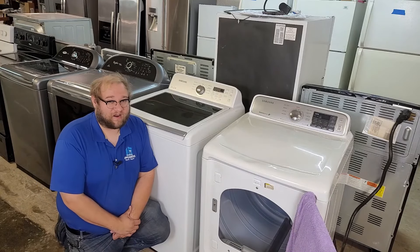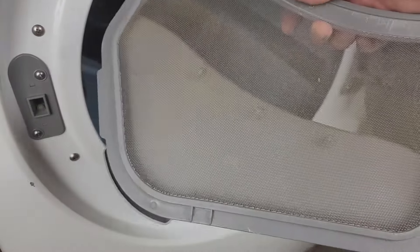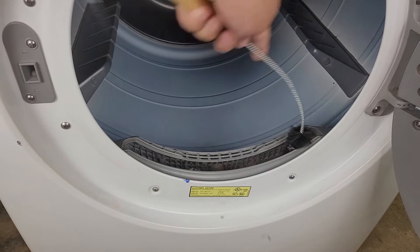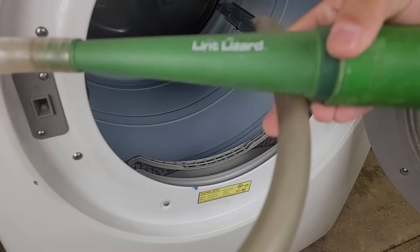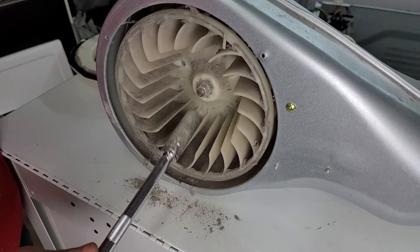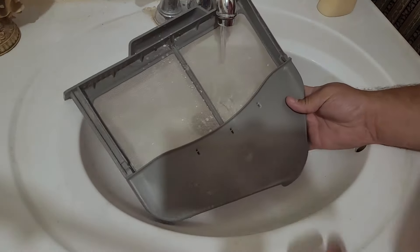One of the first and most important areas to deal with on a dryer is the lint filter. Most people know you're supposed to clean the lint filter after every load, but you can't really stop there — you want to clean the inside compartment every month or two. One way is to use a condenser brush to break up any caked-on lint. An even better way is to use a lint attachment on a vacuum cleaner. The blower housing can contain a criminal amount of lint and dust that can obstruct the hot moist air from leaving the dryer.